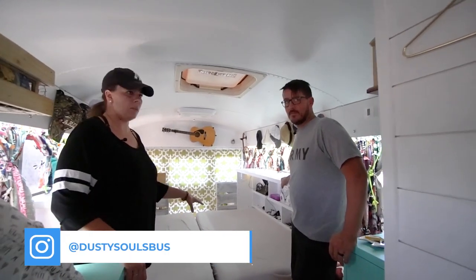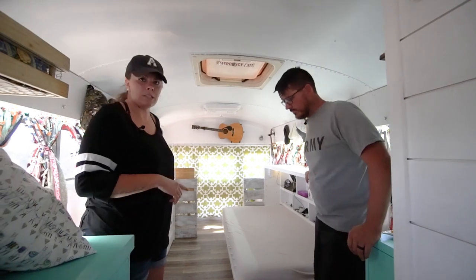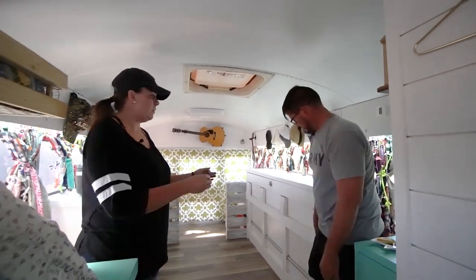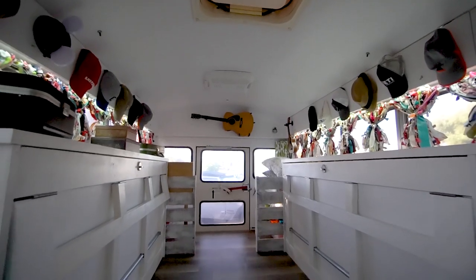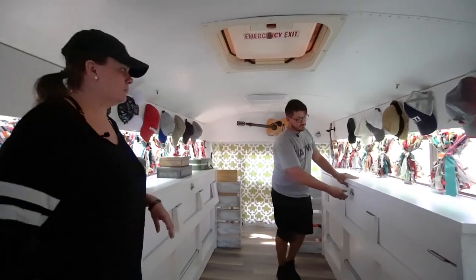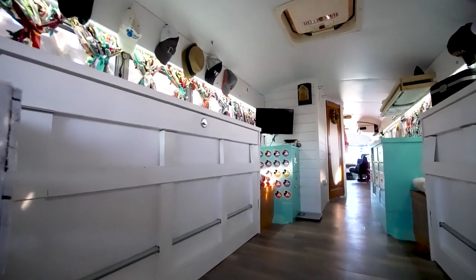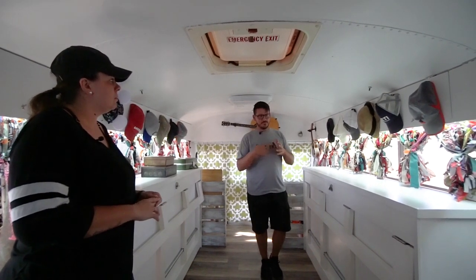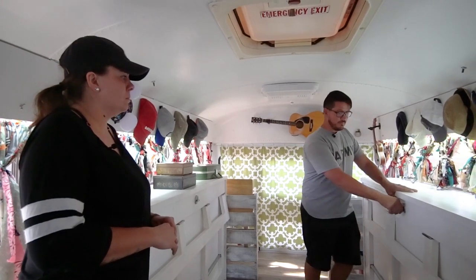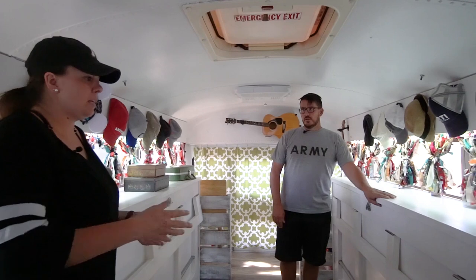For me this is more enjoyable than a loft. This is what the beds look like without bedding before we fold them up — it's really easy, you just grab your side and it folds right up. These are both six-inch memory foam mattresses. The gap in the middle we don't really feel because they were fitted perfectly together during the build — meant to touch exactly as they're supposed to, giving us a king-size bed. They also lock in place so they don't fall down while driving. It's a modified deadbolt: I took the backside off a regular deadbolt, drilled the hole, and cut a little steel pin to make it operate the bolt.